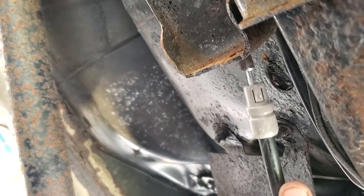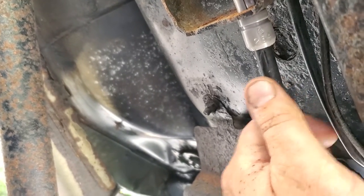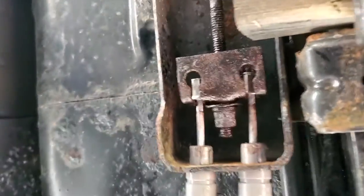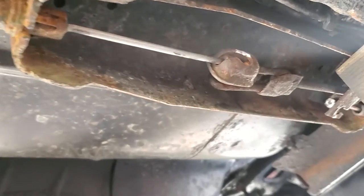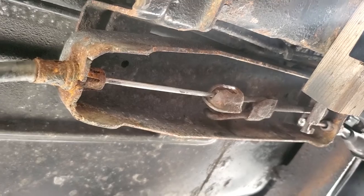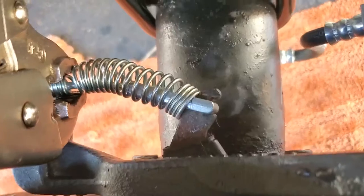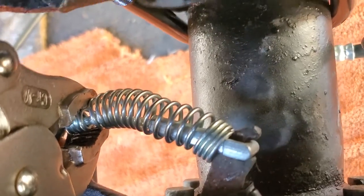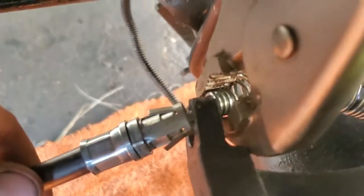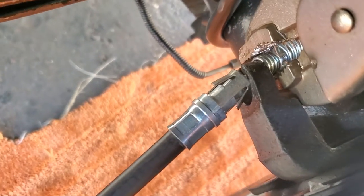All right, we're going to take the lever end and clip it in. Of course, the shorter one goes on the driver's side. Stretch this back into place. All right, squeaked in that new cable. Pretty tight. Sorry, I had to use both hands to get it in. That's in. Now we'll attach the other ends to the e-brake. We're just going to loop that hook right through that little cable. Spreading this thing tight with the vice grip, and then we'll just lock this right where it goes. All right, that little groove.